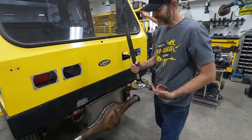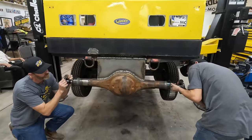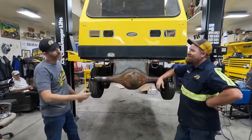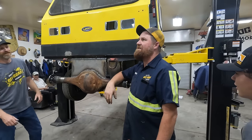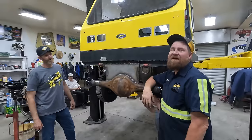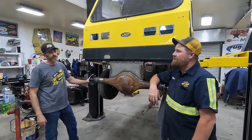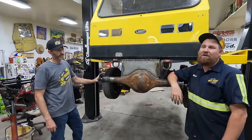Little stubby things. They're so tiny. Looks like you were putting equal torque to what I was doing. Yeah, it was differentiating. The gear ratio that we decided to do on this is a 5.44. We went in 5.38s and they don't make exactly that. So the closest thing they had to that in a Ford 9-inch. So the old Bombi had a 6:1. This one has a 5.44.